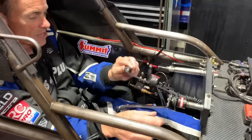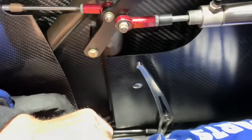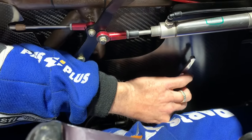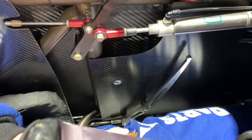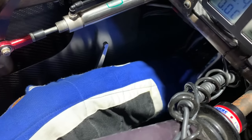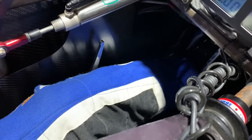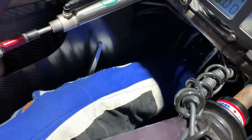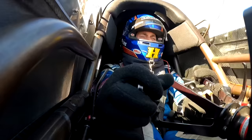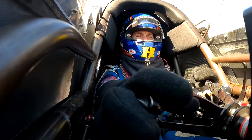Right here, this lever — we do not really have a transmission, we have forward and reverse. So I'll stop, move this lever into reverse gear, and start working my foot in and out of the clutch pedal to back up and maintain whatever speed I want backing up. It's just a little in, out. Never ever hitting the throttle at all. I'll back up to where the team tells me they're good, stop, and simply put the car back in forward gear.